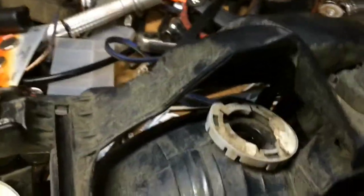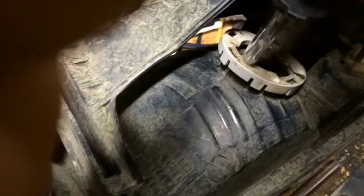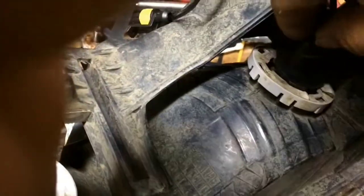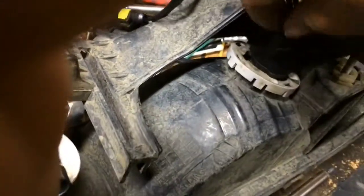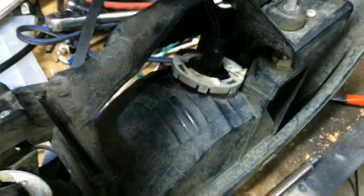We're going to be installing the H.I.D bulb here in a second. Make sure you don't touch the glass. Be gentle with it. Take your time. It should slip down in the slot and fit just exactly the same as any other factory headlight bulb. Simply take your time. Make sure that the tabs line up, and you'll know it'll drop down in. And it's literally like an eighth of a turn to make sure the bulb's secure. You should hear an audible click, and you're pretty much done. Check inside, make sure nothing's touching, make sure it looks good. That's it. Headlight bulb's installed.